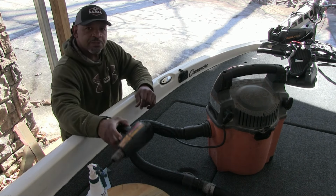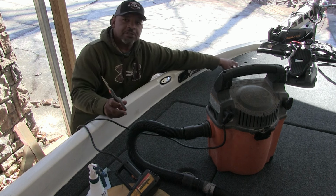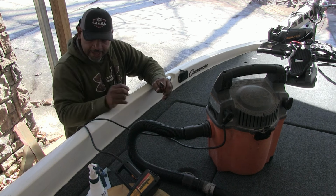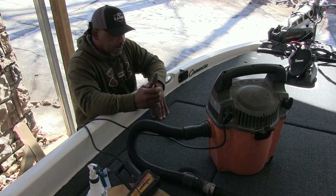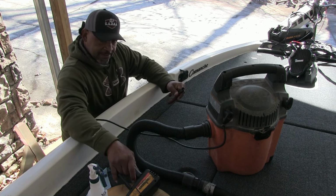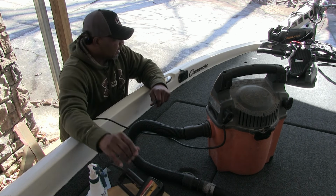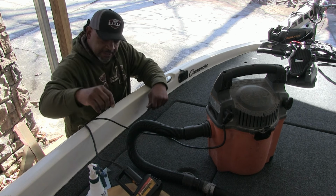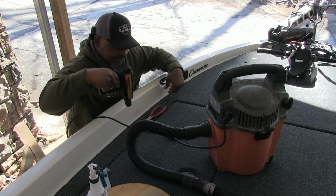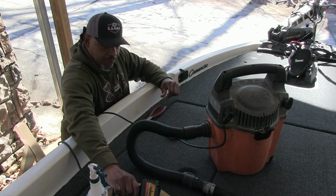And the things that I'm gonna be using is a heat gun, and like I said, I got my scissors, and I got a pair of dikes here that'll actually cut that material, because that material is awful hard and stiff, and like I said, it's cold out here, so it's not the most pliable thing that you can just cut with any kind of cutter. So that's what the heat gun is for. As I'm putting it down, I'm heating it up to get it pliable for it to actually bend, and you can make it go into different shapes. That's what the heat gun's for.